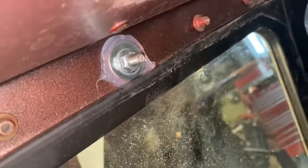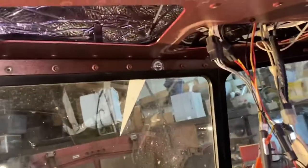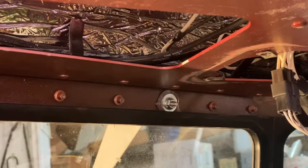Do a little Hall County customing. Had to do a little bit of Hall County custom work, y'all. Them little rubber well nuts didn't suck up quite good. So I went and got some fender washers and some lock nuts and some silicone. That's what I'm going to use on the ones that don't grab good to help hold them. So hopefully it works out. That half inch hole, the drill seemed like it was a little too big. So I'm going to drill the hole a little smaller and see if it'll grab hold.